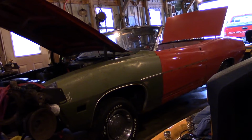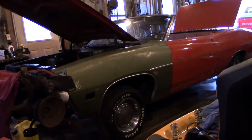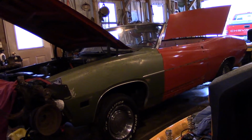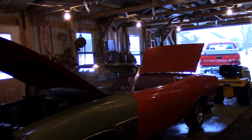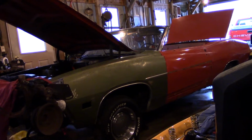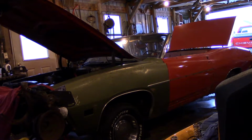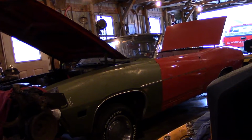But basically, what the plan is, I think the front fender here is going to go back on, because what needs done is the car itself needs braced up. Going to weld the doors in and put some cross bracing in the passenger cabin there to basically strengthen it up. And then we got the mounting hardware for the rotisserie to hang it from the bumper mounts, I believe, in the unibody in the rear. I think is how it's going to be set up.